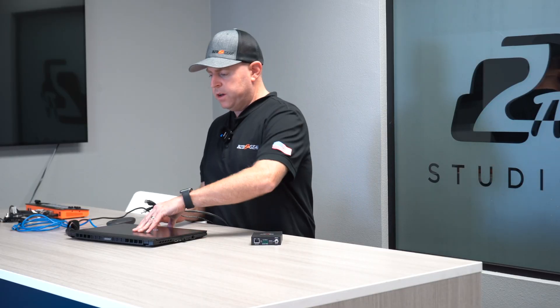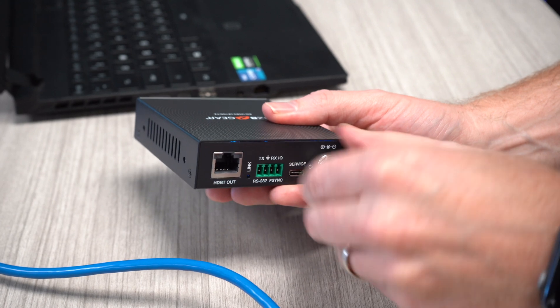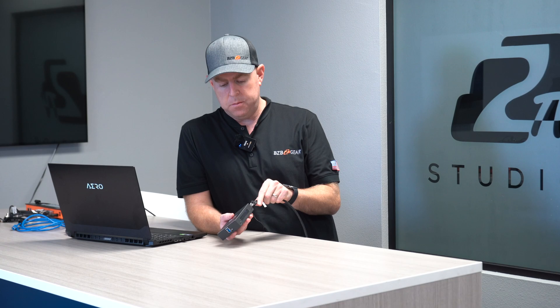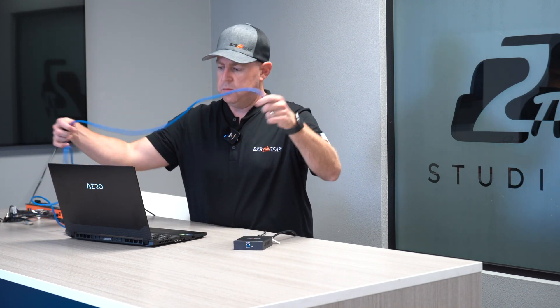First, for our setup, let's go ahead and open up our laptop. As you can see, we have our TX on this side — this is the host side. You want to plug in the computer that you're going to have the USB input coming into. I'm going to power it up because we have the receiver on the other side. I already ran a CAT 6 cable across the room going right into the box, and it powers on. You'll get a link green light right away — boom, there it goes. It says USB host on here. It's just a USB 3.0 B-type cable, and I have it connected to the computer already.